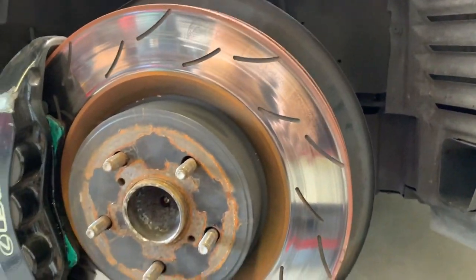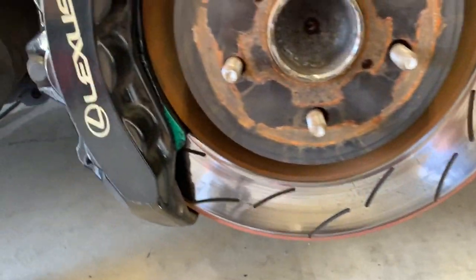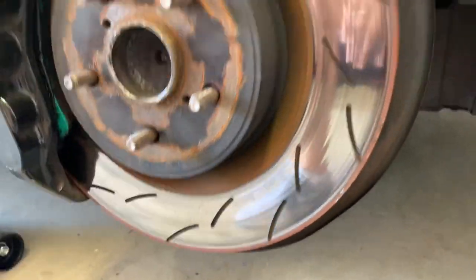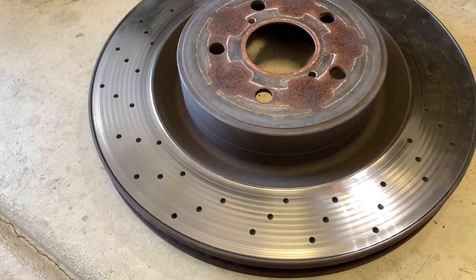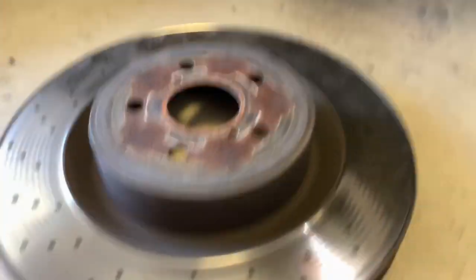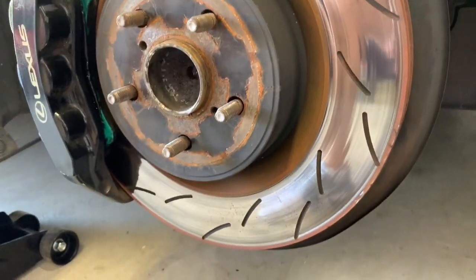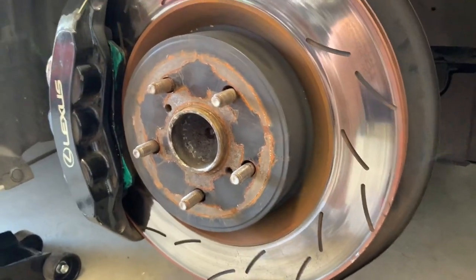Here is what these rotors are looking like right now. As you can tell there is a lot of rust present and that does not look very good. All over the rotor — I've not just washed my car, so it's not the post-wash kind of rust look that you'll get on your rotors. Here is a stock rotor that I still have. I've had this one on my car for about 10,000 miles at least, because these are the ones I bought my car with until I switched them out. You can tell there's hardly any rust on these compared to how these look. That does not look very good between the two. This is one of my main gripes with these so far, because it's supposed to have this e-coating which I'll talk about in a little bit, that is supposed to prevent rust, but it's not really working on this pair, and this is the same on both sides of my car.